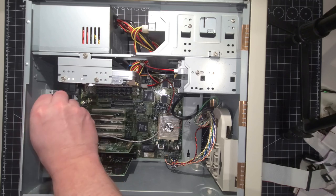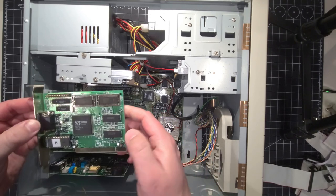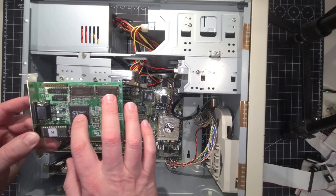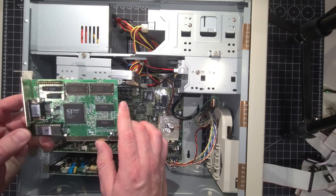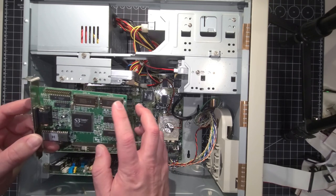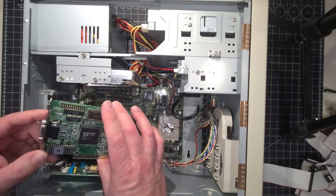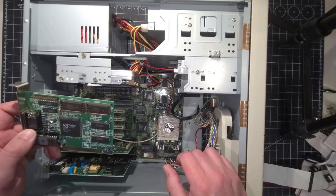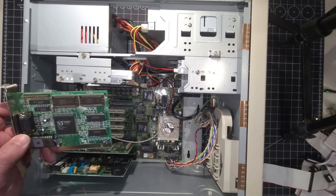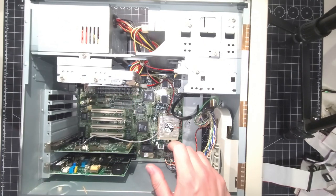Back to the video card — let's go ahead and remove that. One thing I alluded to in the last video is the actual video card itself. This is an S3 Trio 64 V+ video card with expandable memory, which has been expanded. I had to remove this chip here from the board because it just wasn't working — it was giving me error codes as it was trying to boot. I was able to fix that by using Deoxit, and that's what enabled me to get this card back and running.